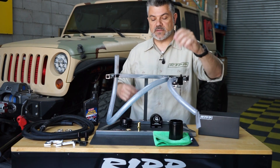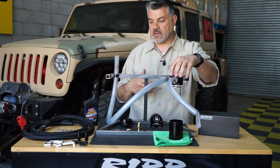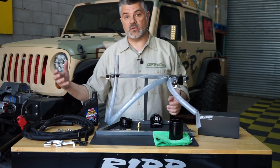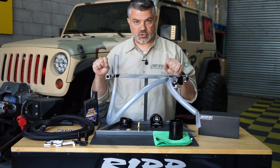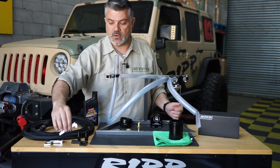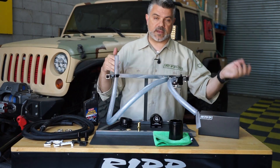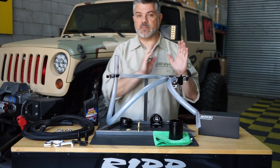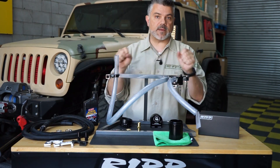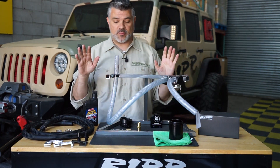There's also a plate with holes in it which helps slow down and coagulate the oil even more, giving you a clean filtration system. The placement of the hoses is also very important. When you buy a RIP catch can system you're not just buying the can itself — you're getting a system. These are Gates American-made nylon-reinforced hoses, so in boosted applications they won't vacuum shut when hot, expand, or create a boost leak. You also get billet aluminum brackets specific to your vehicle — whether it's a Wrangler, an LX car, and so on — plus stainless steel clamps and OEM connectors depending on the vehicle.